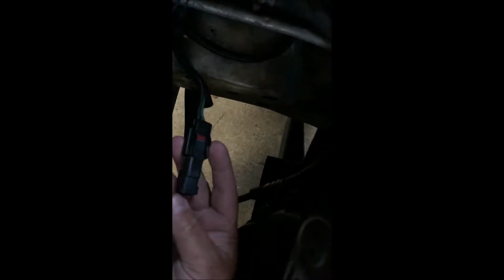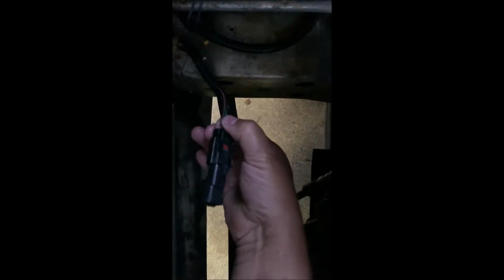Okay, folks, I was talking about the wire color and what I was trying to remember to get together. Well, come to find out, the wire color on the fan motor, the aftermarket fan I bought, is different than the one on the car, obviously. So I plugged it in real quick, just kind of hooked it in to make sure I get my colors right. So on this right-hand side here, what I'm going to call right-hand side is green, goes to blue. Anyway, green goes to blue, and then this purple and black stripe goes to black. So I gotta get that right and make sure when I cut this, I get the two colors matched up, so the fan runs in the right direction. So I'm gonna cut that, solder it, we'll be back.